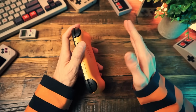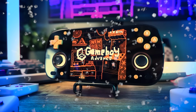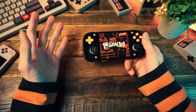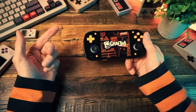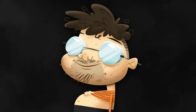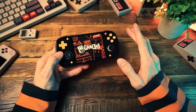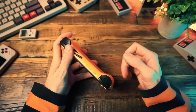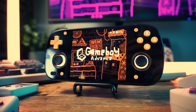Cold, on the other hand, makes the battery sluggish. It doesn't cause permanent damage, but it makes the battery drain faster because it makes the ions move slower and get lazy. Like me after a big lunch. Cold doesn't cause permanent damage like heat does, however, don't charge it while it's freezing. That can cause damage.